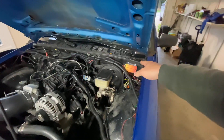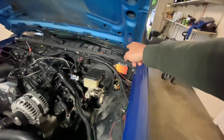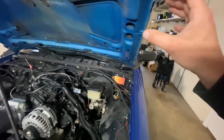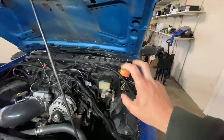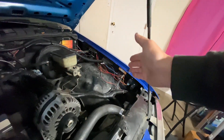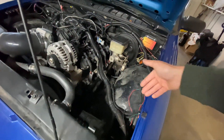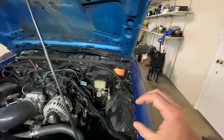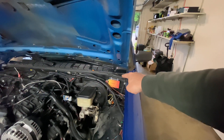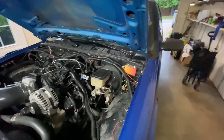Here's a quick rundown of what we've got going: the LNC box plugs into the coil packs and the coil pack wiring harness in the main engine harness. I have a 12-volt activation wire going to my brake pedal switch — it has to be hot only when the brake pedal is pushed — and that activates the RPM limiter two-step. I also have a ground wire coming from my NOS Progressive Mini 2 controller going to a relay that switches over to 12 volts, sending 12 volts to the timing retard activation on the LNC 2000, which pulls the timing for the nitrous.